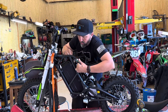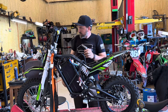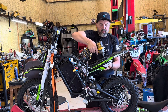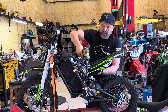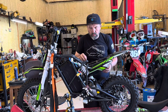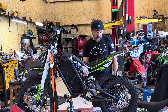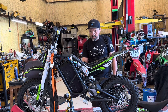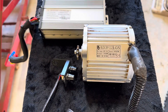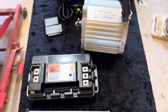So this is the motor wires here — this goes through the controller. I'll drop this controller out. Kind of interesting how loose those were. Controller is out. Up next, I'll loosen this chain up and then pull this motor off. We've got all the parts out. There's not a lot to take off the bike — it's pretty much the whole powertrain. The throttle, the response and speed adjustment, the motor, and the speed controller.